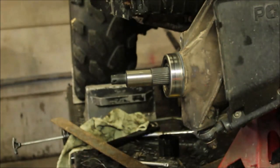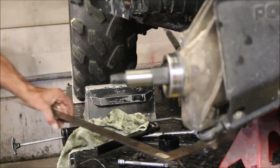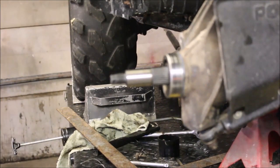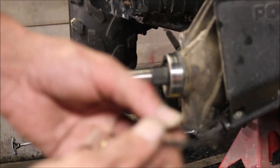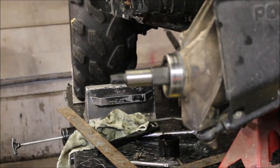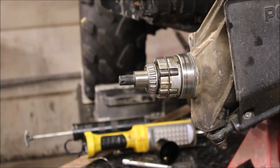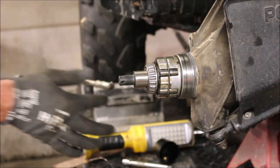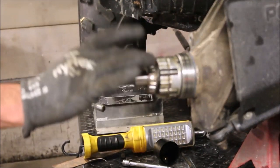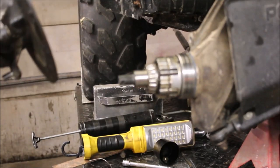Let's get the key on, make sure you're in gear, and I'm going to test that out. You also want to make sure this ring is completely flat or it's not going to work. If there are any imperfections in it, it might not stick. I've got my bearings greased, I'm going to throw that hub on and tighten everything up. Make sure I fill this back up with hub fluid.